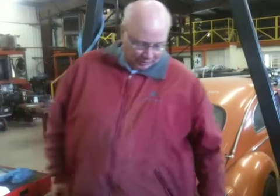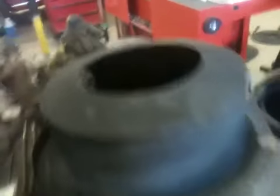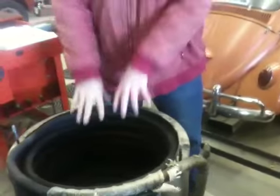So what we have here is a boiler from our Keen car. This one's good enough for about 140 horsepower and about an 8-gallon an hour burner. This is the top and that's the bottom. The burner, which is an oil furnace gun, comes in at an angle here. This is the combustion chamber. That's upside down, but that sits in here. So the flame goes around in this stainless steel thing and it burns, and then the flame goes down and there's an opening in the bottom that the exhaust goes out.